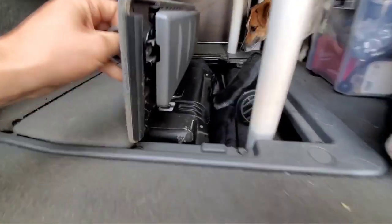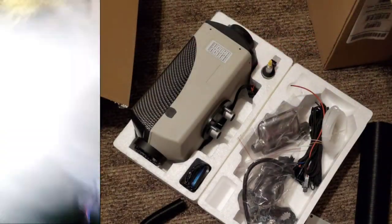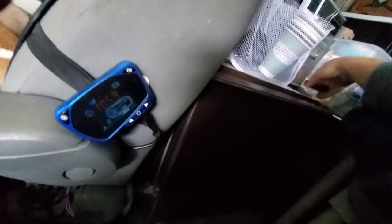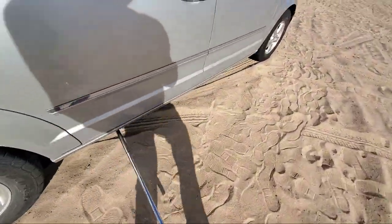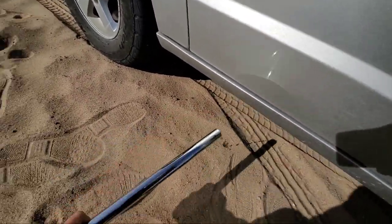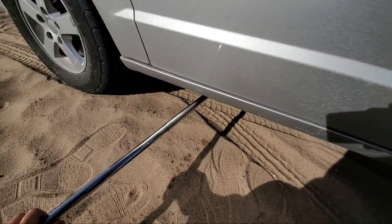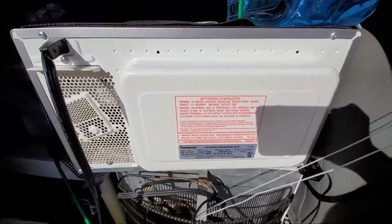Under the front there's storage for my camera equipment, and then there's the diesel heater outlet. The diesel heater works just fantastic — it has thermostat control, set at 25 Celsius, and a remote I can adjust while sleeping. The exhaust runs under the car, but whenever I camp for longer periods I attach extra piping so the fumes get further away from the car, since without wind the fumes can sneak back in. I have the diesel tank mounted behind the fridge and microwave.